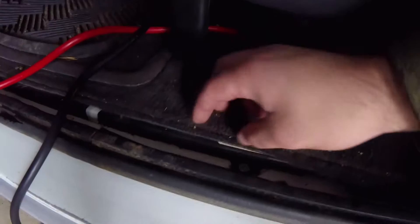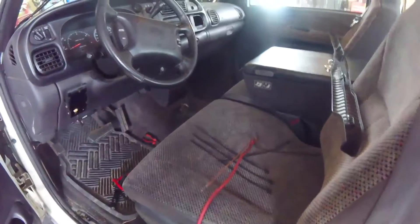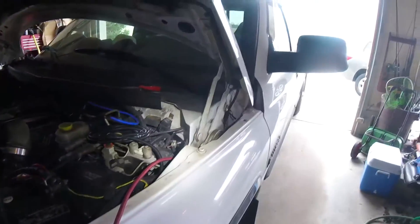I think I'm going to run the wires through this hole, then cut a hole down here in this part, run them through there, and see where we can go from there. As I was expecting it gets pretty tight up there and it's kind of hard to run these big wires through, especially with my big hands. So I'm going to go for the old zip tie to welding rod trick and see if I can poke it up through that pass. With this method the old welding rod trick works pretty good. I'll route those up here and tie them right into this battery.